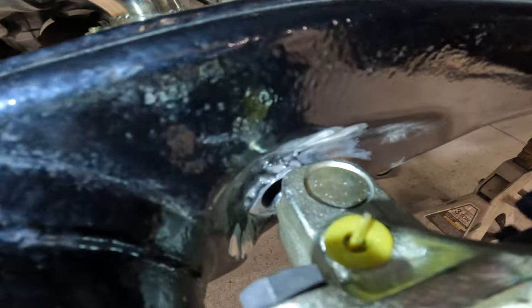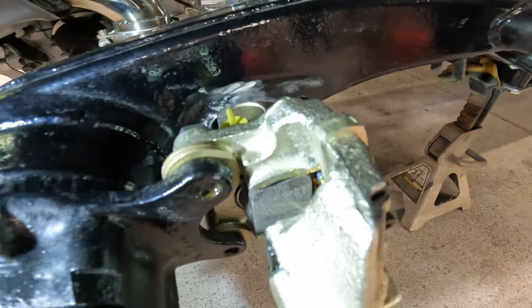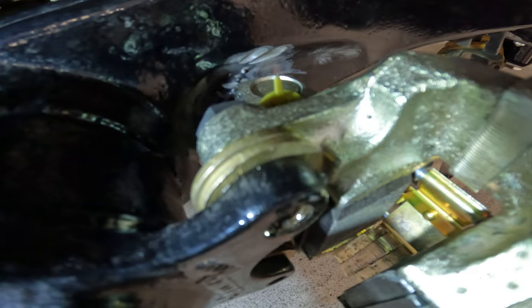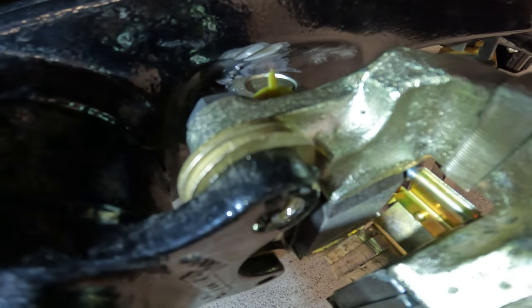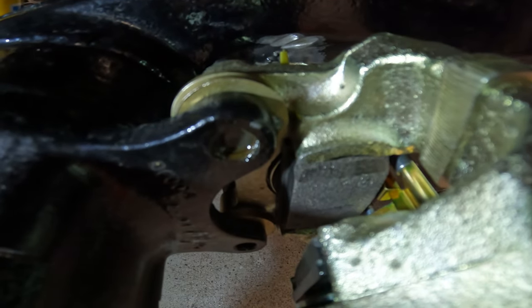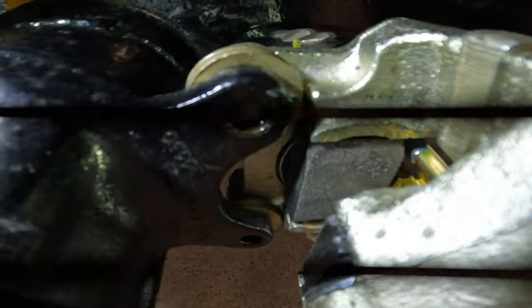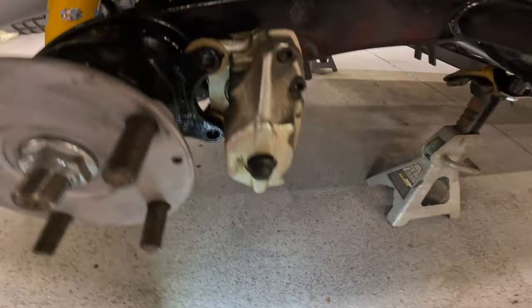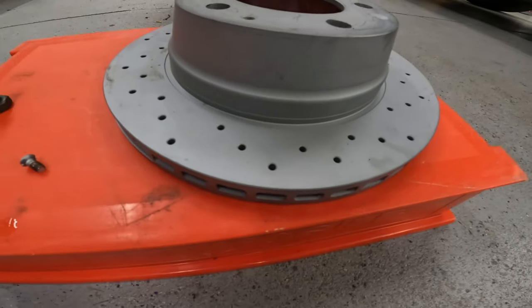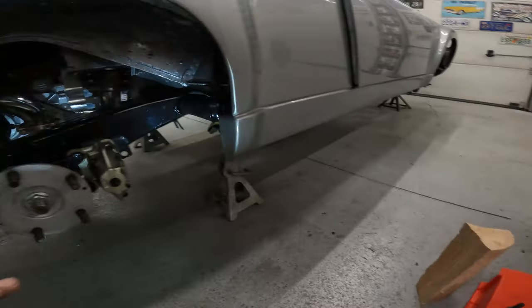I got through the grind. And if you look way, way down in there — I'm going to hold this thing really still — you can see how I've moved the caliper closer to the actual trailing arm, and how this entire caliper is now moved over five millimeters according to my math. I've got these hardened washers — they're not the right thing. I'm going to get a guy I know who can turn this on a metal lathe to make me some hardened five millimeter thick distance blocks. That screw is exactly three centimeters from Porsche — I need 3.5 so the threads go through. I pushed this in five millimeters so I can fit this 24 millimeter thick vented disc.